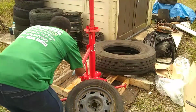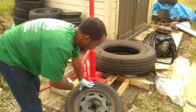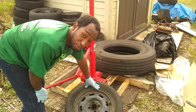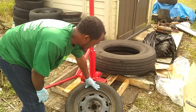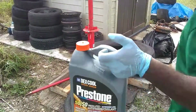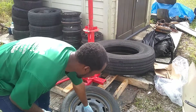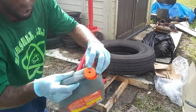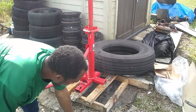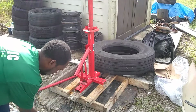So, of course, first thing you're going to do, take out your valve core, let this thing take some time to come out. Typically, you want to go around the edges with some type of lubricant, because I found that it's extremely hard to do it without it, so let me go get some of that. I got this in an antifreeze bottle that I've cleaned, but drilled a hole through the top. You need tire mounts and lube. But you're just gonna go ahead, throw some there, let it soak all around, kind of like you're doing a big truck. I just don't have a hammer.